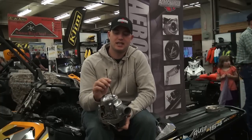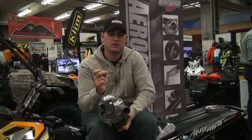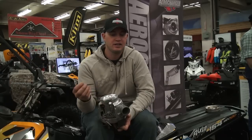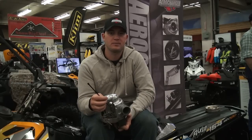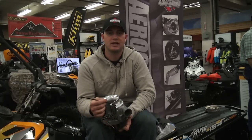The one without a hole — you'll take that one out, grab a zip tie, stick it down in that hole, pull it out, and you're going to want to see an inch line of oil on the zip tie. If it's less than that, fill it up to the inch line. Get the oil right from Aerocharger's website — it's a special kind of turbine oil. When you put the plug back in, make sure you use red Loctite on that.